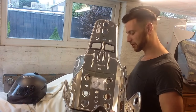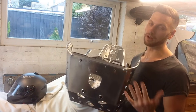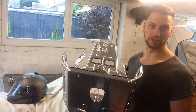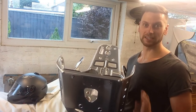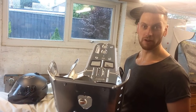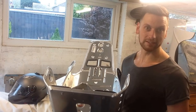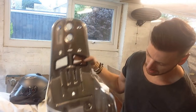I don't really need to be fitting seats much at the moment — it's more about the brackets for mounting underneath to the floor of the Mini. I want to make sure I've got all the holes drilled and all the bracketry made up, make sure it all fits with the frame in there before it goes off to paint. I can get all that fabricated, take it back out again, and I'll be more practiced at fitting it back the second time, so I'm not knocking fresh paint trying to work it all out.